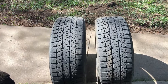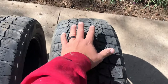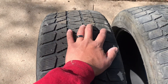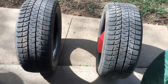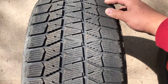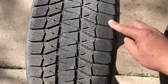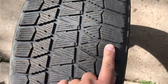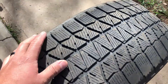Hey guys, Ralph here. Today I'm going to show you how to check your car if you have a bad ball joint, and for our Nissan Juke, if your control arm needs to be replaced. Number one indicator is the wear and tear on the tread of your tire — this one is balding on the inside, on the inner part. As you can see, on this side it's already balding, and I just bought it this season.